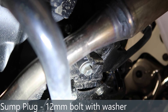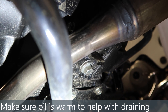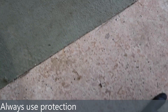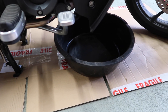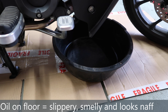I've ridden this bike a little bit today. It doesn't have to be screaming hot, it just has to be warm ideally so the oil flows nicely and you get it all out. You can see I'm protecting the concrete with carpet, and the carpet is being protected with cardboard. I've got an oil catch pan — a washing up bowl would do, just anything — because there's only about a litre coming out.